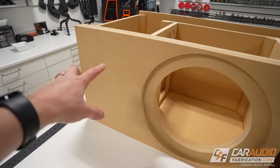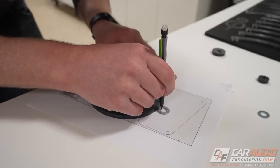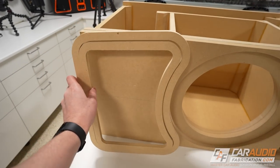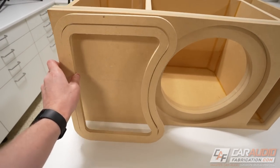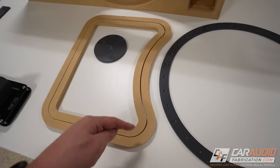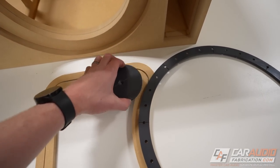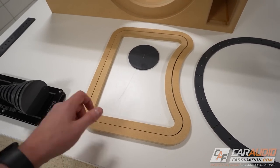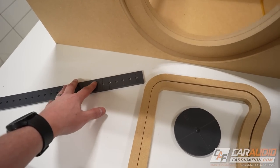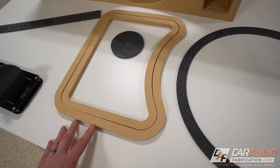Let's get started. On our custom subwoofer enclosure, here is the area that we have to work with. On this particular build, in order to come up with a shape for that area, I started with sketching out some ideas. Ultimately, this is the shape I ended up deciding on because it's relatively simple and will give this enclosure a nice clean look. This particular shape is made using basic geometry — different circles combined together to make the curved areas, and straight templates for the straight areas. This can all be done with a variety of templates on the router table using the shape-making process I've shown in previous videos.